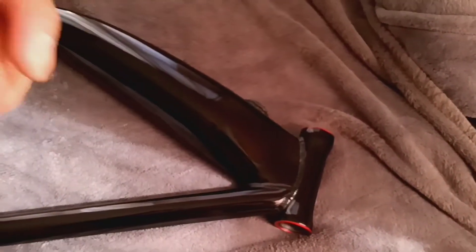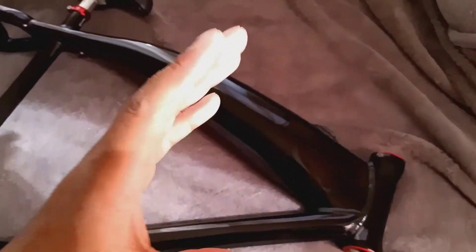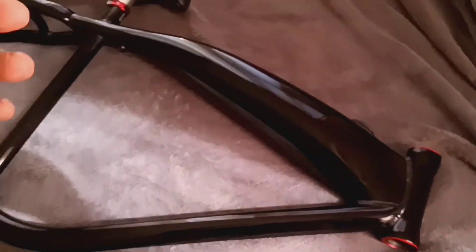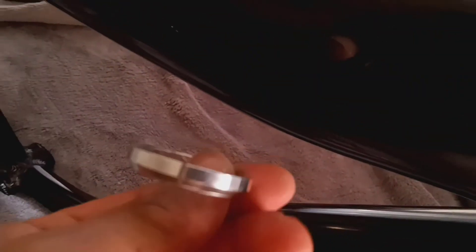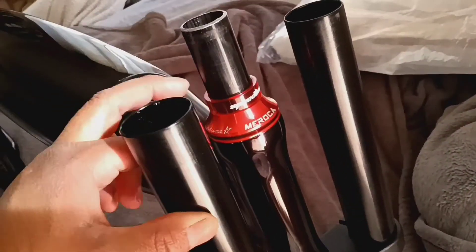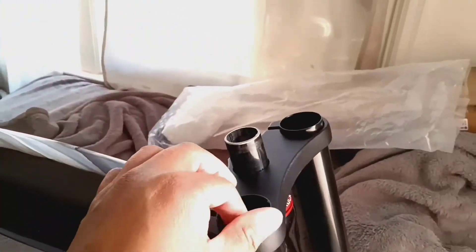You can see I cut the head tube. Definitely when you're going all out and making it nice to your liking - this is anodized, not paint. I'll show you the setup: first, basically put on the forks, then install the headset shim like that, then install the headset dust cover. I'm running one of these Speed Line spacers - ceramic and red. Then you install the top of the triple tree, and I'm gonna use one carbon fiber spacer.